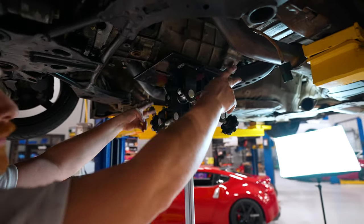All right, so we're inside the car. We're almost done, close to the end. So the shifter spring pops in the top. That's the same up and down. You're gonna put your shifter in with the reverse lockout knob pointing towards the passenger side. Slide it straight through and push your little cup down into the transmission. Oh, it's like a jack in the box. Take your plate, put it on top, and then using your 10 mils, get these started.